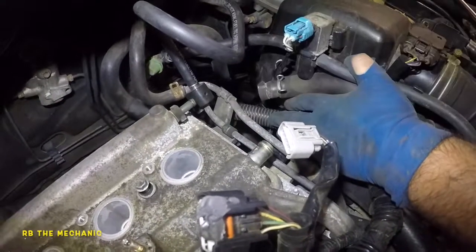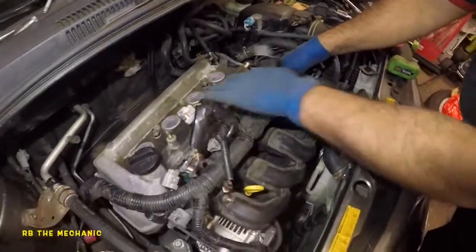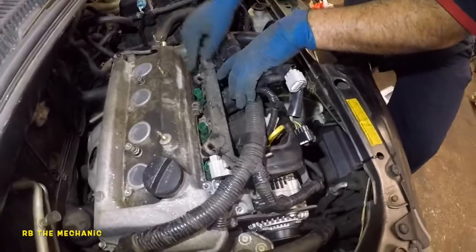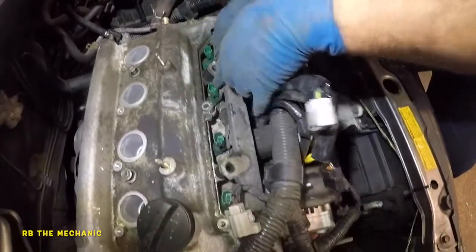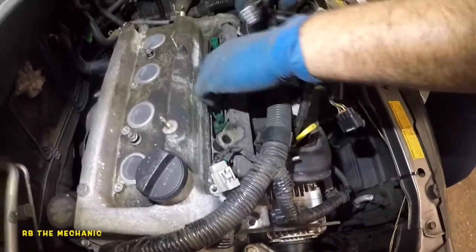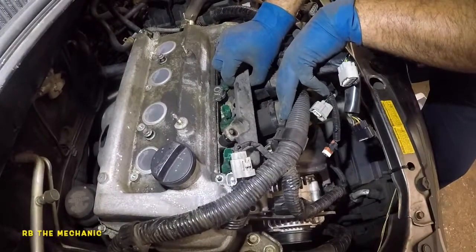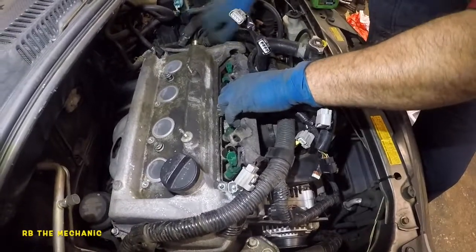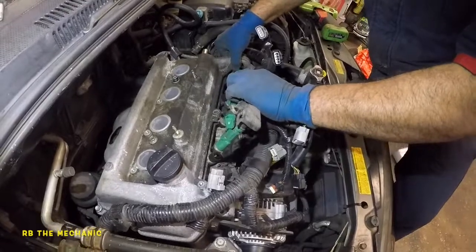Okay, there you go. This is loose. So remember, we're able to lift this valve cover and get this guy out of there. But this thing has two little plastic pieces, like little spacers. So what I like to do is grab the injector and slowly lift them. Sometimes they're stuck in there. Remember, we did the engine, so they're pretty easy. You might have to yank it a bit. But all these lines are out, and these injectors are pretty easy to take out from right here.